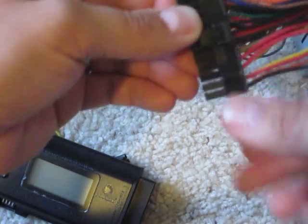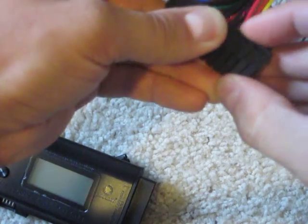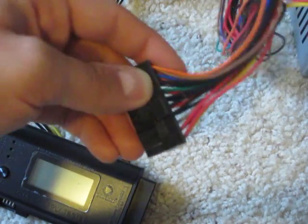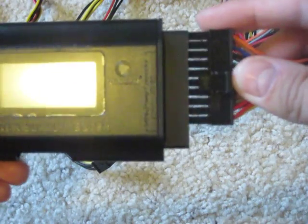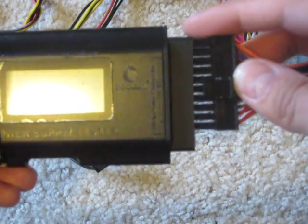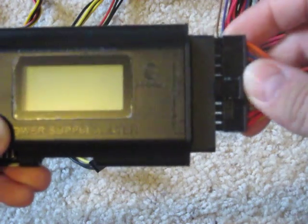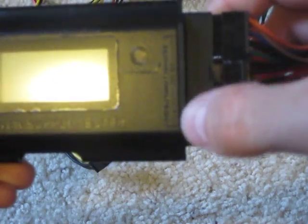Now, let's say that you had a 20-pin connector instead. As a matter of fact, this power supply can do both — it actually detaches this part. If this is a 20-pin connector, you want to start from the top and down, so it's got to be aligned like this, not like this. You have the markings right here — it'll say 20-pin, 24-pin. Plug that in.